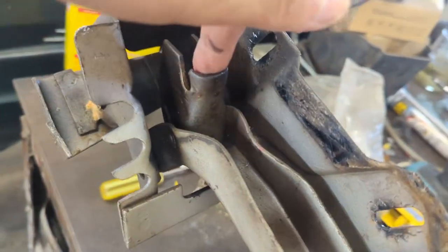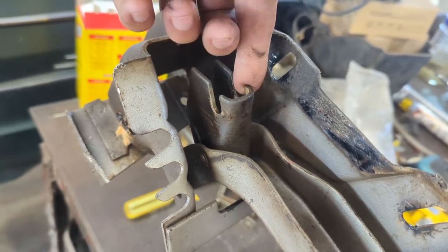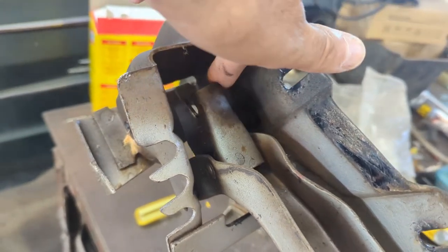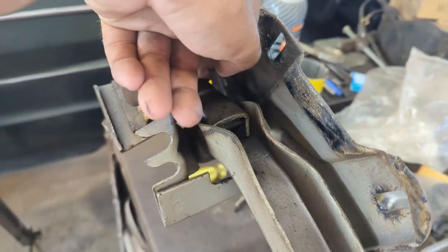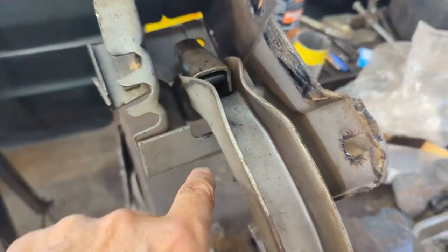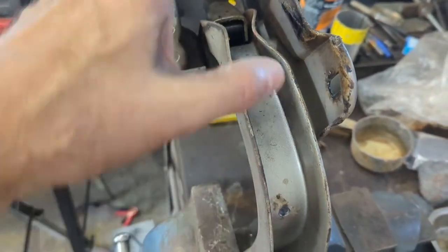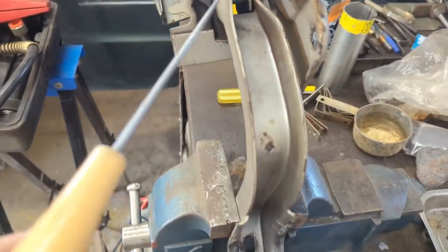The torsion rod for this is tightened on the passenger side and the loop is on the driver side. They go up in there and, because they're in the right position, they just bend over by pushing the torsion rod back and forth. But this one won't do it because the piece is in the wrong spot and it's binding.